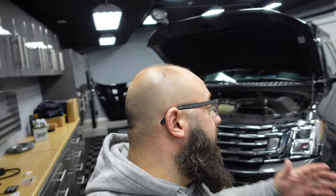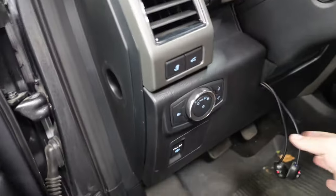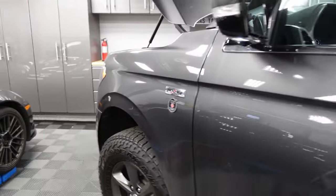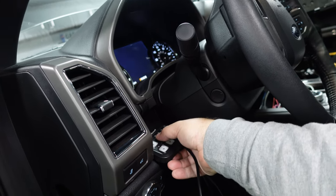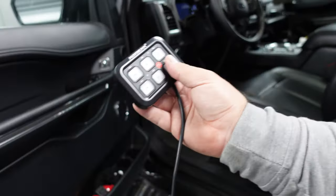It is the next day. It got down to 28 degrees last night. I don't feel like freezing my butt off and getting sick, so I am in the garage where there's a lot of light compared to yesterday's video. Currently I have these two switches — they were attached here and they control the lights on the winch mount. I need to remove those because this baby is going to go there: the aux beam six-gang controller. If you want to get one of these, there is a link down below. I'm going to mount it right here so I will be able to control the two lights in the front, the big one on the top roof rack, left, right, and the rear.